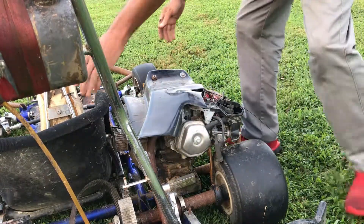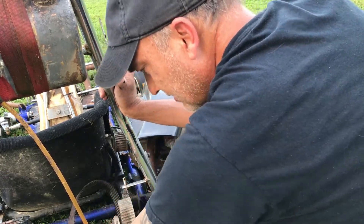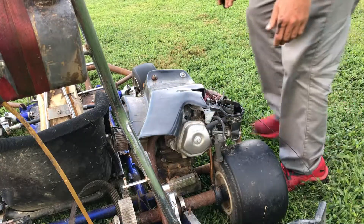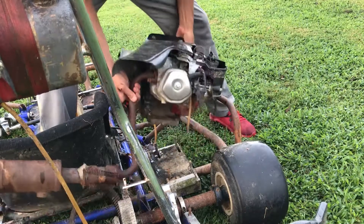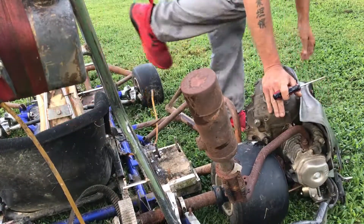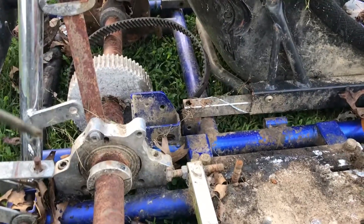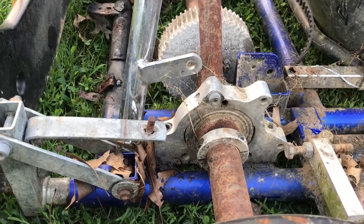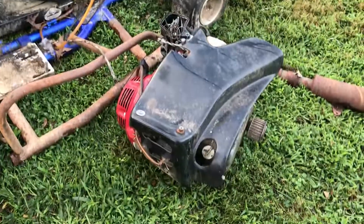All this exhaust — we've got to disconnect it, I forgot about that. I think I'm just going to take this free and try to take all of that at one time, because I'm not going to use any of it. And there we are, guys — get everything off to work and see what we're working with. Like I said, I'll put a Predator 212 on here, change these tires, and get a sprocket carrier for this big axle. Clean everything up. That's about all I'm going to do today. It may take me a while to update on the next video, but I'll get it to you guys. Thanks for watching, see you later.